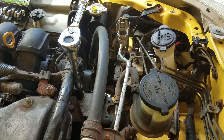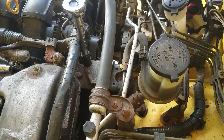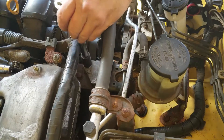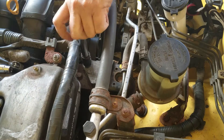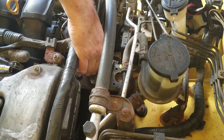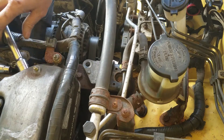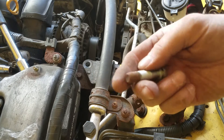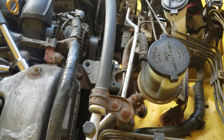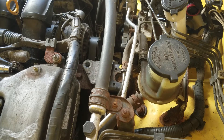Let's see how much you guys can see — there's a bolt down there. I've got that, I've got that, I've got that. This bolt was pretty easy to get started loosening as well. All of these bolts — the ones from below, those nuts — were pretty easy to get off. This is pretty easy to get off. I might put some copper anti-seize back on this when I put it back on. You can see the exposed thread portion has a little bit of rust; everything else still looks pristine.